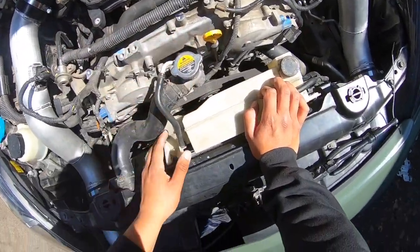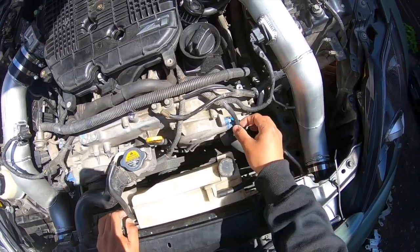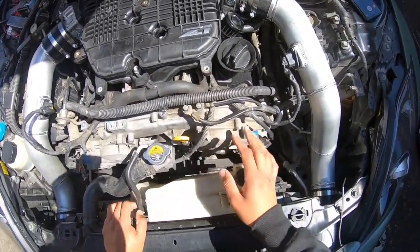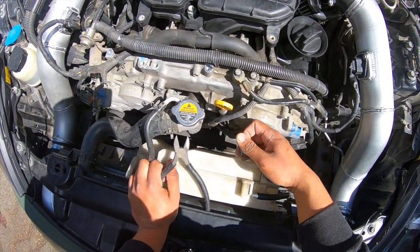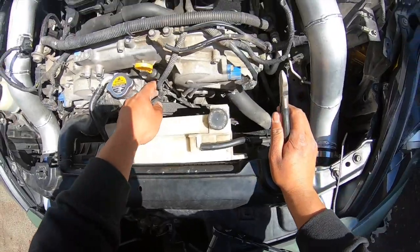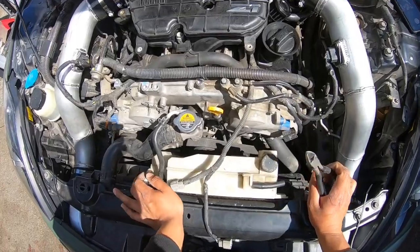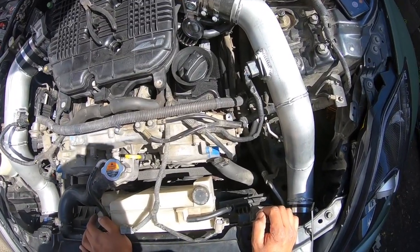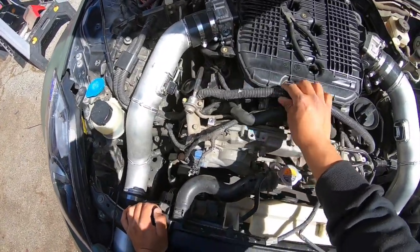What we want to do is just disconnect all the wires that go up here — these connectors that go underneath like the water inlet. You'd want to disconnect them just because they're all going to get removed and located somewhere else. I would recommend doing this when the engine is cold. If you've never taken these connectors off before they're going to need a little bit of love and a little bit of persuasion, because Nissan plugs are just so hard. Now we just pull all this stuff out. These connectors only go into one connector, so if you mix them up they can't go in — so you're good. Disconnect all of this stuff and it gives you a lot more wiggle room to move things around.